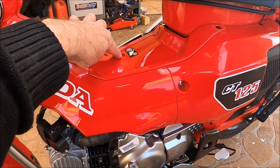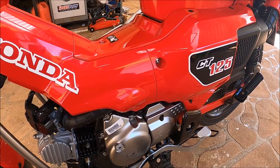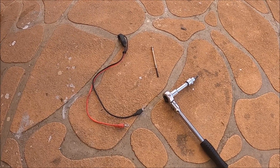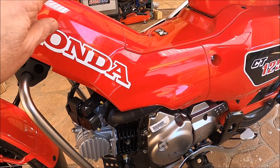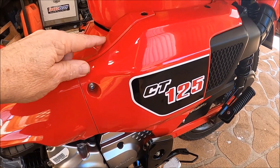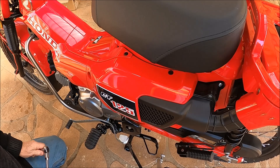Anyway, that's out of the way. Five mills here, five mills there, two push pins up in that area there, and you can start pulling the plastic out. The reason I'm going this way — there are three sections involved — is I've decided I will put the battery tender on, the C-Tech one I've got, so that later on I won't have to pull all this off just to do a battery charge. More importantly, I've got a centre rack to go on here, so once I put that on and close this section up, I'll hook up the pigtail and the USB port. It could be a tight fit — we'll see what happens.